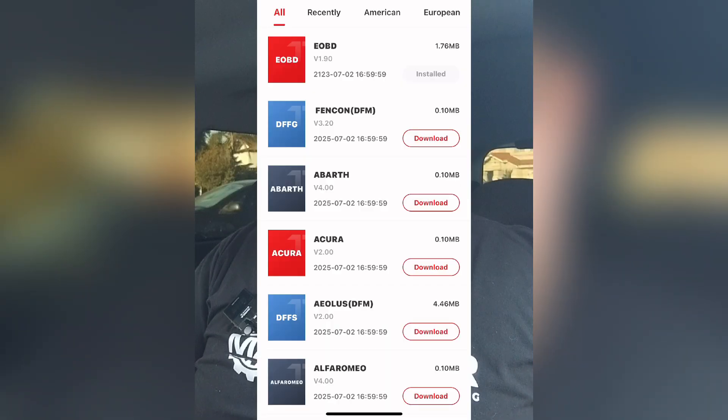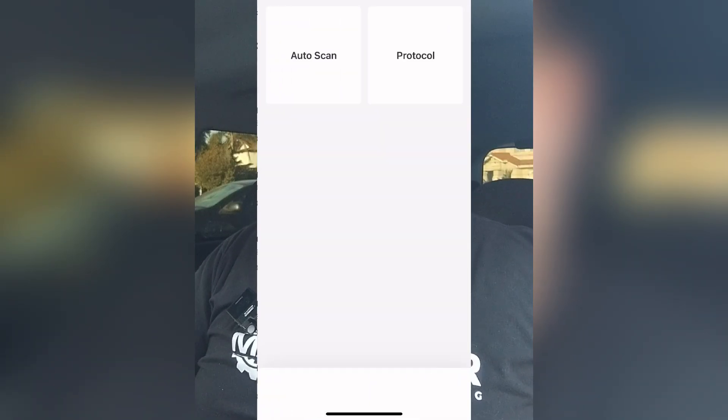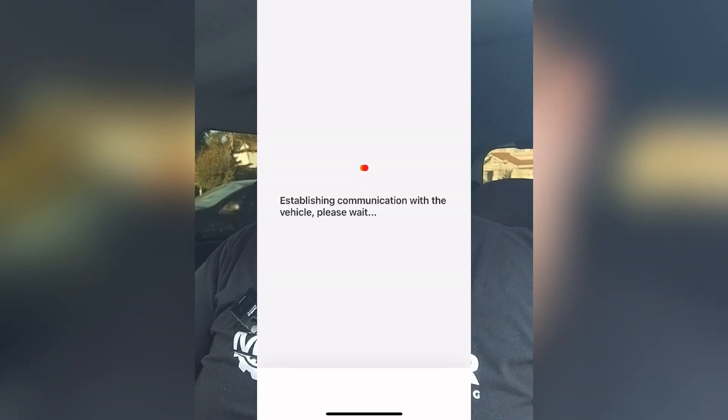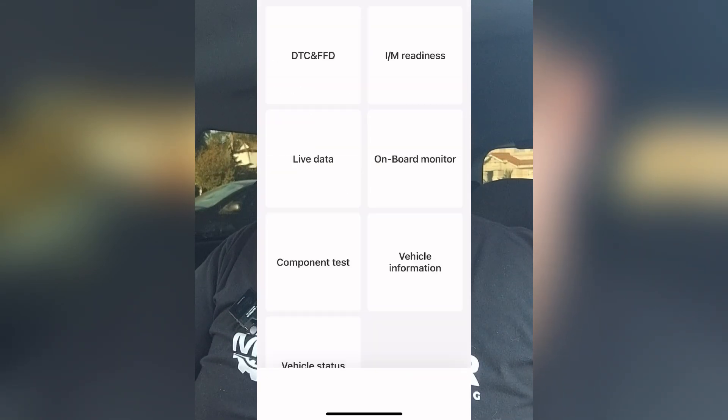If you've been following me for a while, you know I'm a big proponent of using Global OBD2 for drivability diagnostics. We're going to go to EOBD, and if you don't know your protocols yet, you can do the AutoScan — but this one's CAN, so we'll select the CAN protocol. Right now my phone is communicating to my dongle where we'll be getting all the vehicle information we need. We'll hit OK and go to Live Data.